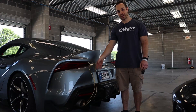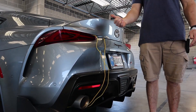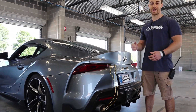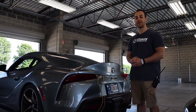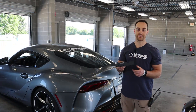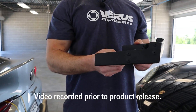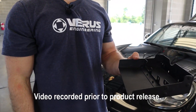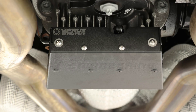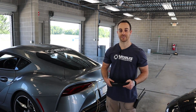The wires you see on the rear of the car are two thermocouples on the rear diff, measuring its temperature on track. We have an AIM Evo 5 in the car measuring the car's data as well as these two thermocouples. This is the rear diff cooling plate that we're going to be releasing soon, as long as it actually works. It installs to the rear diff with four bolts and four nuts — really simple install, takes maybe 10-15 minutes. But we've got to get to the testing, so let's go.